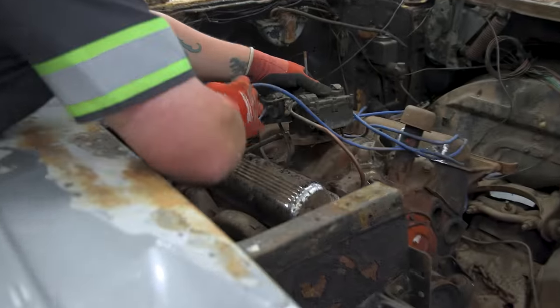Now to work on the lowers - just cleaning up the surface where the washer and bolt will mount flush so there's no obstruction. I got it right the first time on which side is what. The way you can tell if you have the right lower control arms on the right side when installing new ones - the easiest way is to take one side off and match it up. We didn't do that because we were in a hurry to get this whole thing gutted. The way you can tell with the wrong side control arm up is the spring pocket doesn't line up with the spring bucket and the lower ball joint is way off from the upper - they should be almost straight up and down from each other.